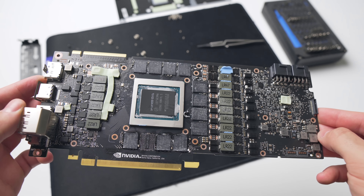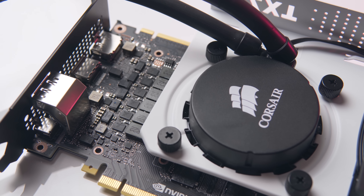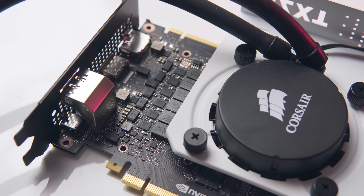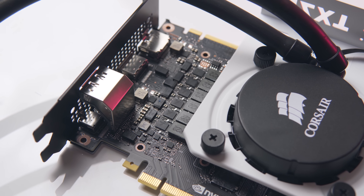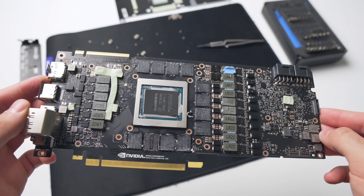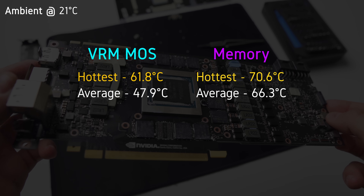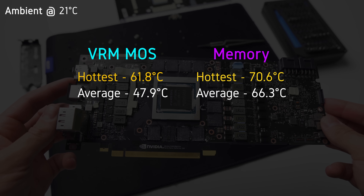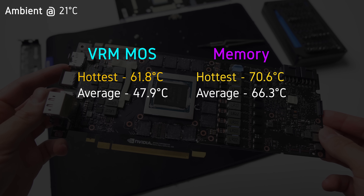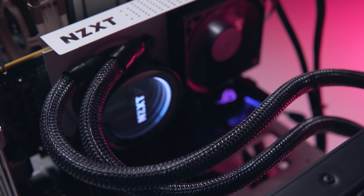This means one side gets directly cooled by the 92mm fan, but the smaller portion of the VRM doesn't really get any direct cooling at all. Although we're mostly focusing on GPU temps and fan noise, I still wanted to make sure these components were running within safe levels. After running Heaven 4.0 for 20 minutes, I measured the surface temperature of every single memory chip and power stage on the PCB, and overall I was pretty surprised with how cool they were running. It's safe to say that you wouldn't need to mount additional heatsinks to the VRM or memory chips, as these temperatures are quite safe — although it certainly could help.